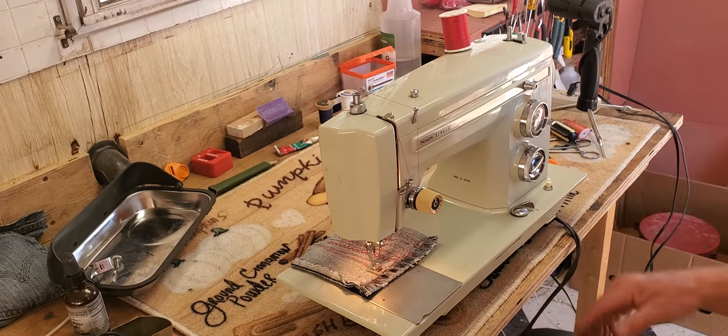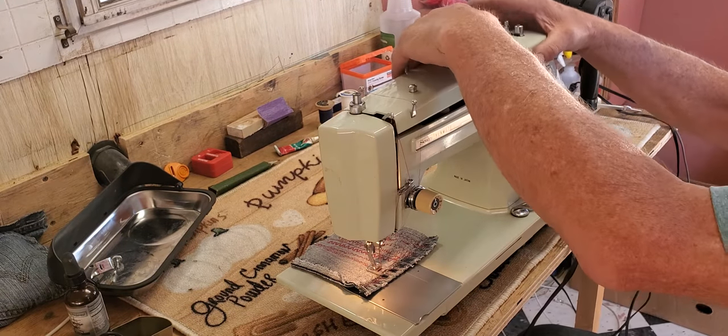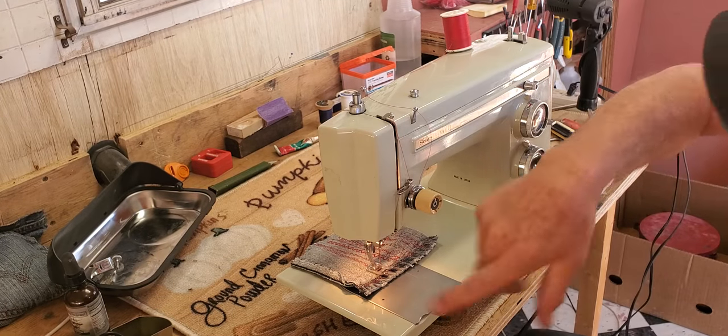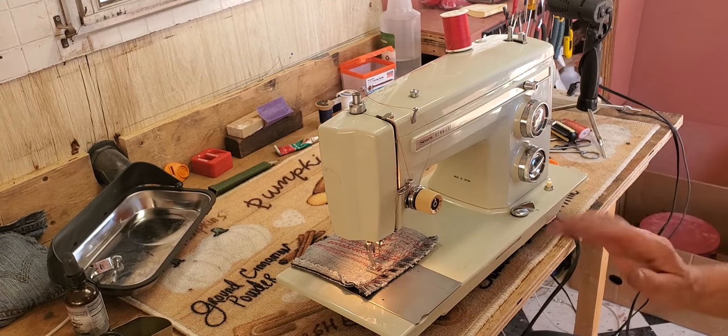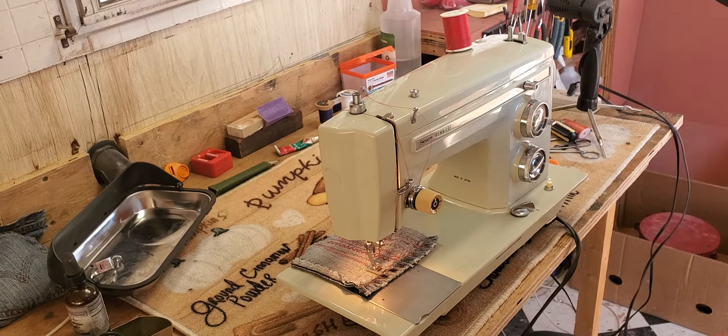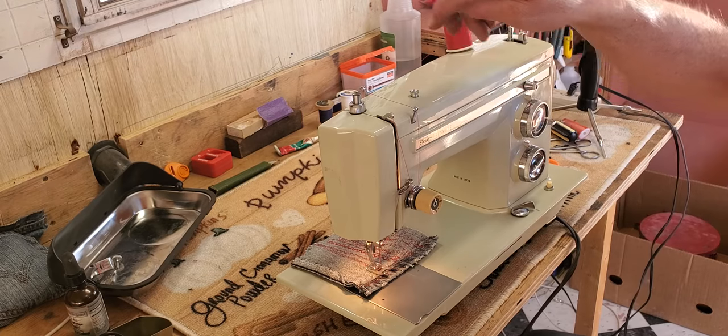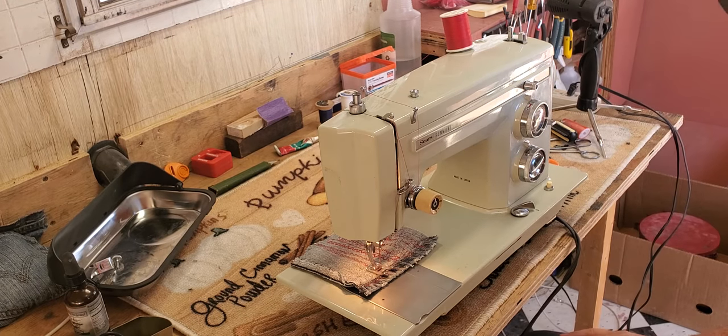And look underneath, brush out the dust and lint, and your top lifts off. If there's any dust or lint in there, you want to brush and vacuum that. Brush and vacuum the lint and dust out of everything. And then, following the guide in your user manual, you're going to put 1 or 2 drops of oil at each oiling point.